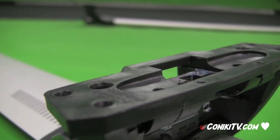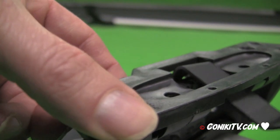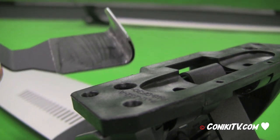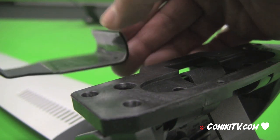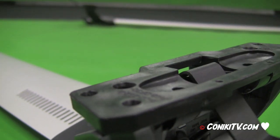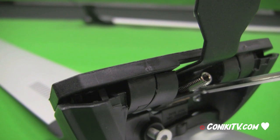Turning the bar upside down to demonstrate: the bracket has to fit in from below, so lift the bar up slightly, push it in, and it hooks in underneath. On the fitted bracket there is a little plastic coating — peel the adhesive tabs and place them on the bracket surface. This stops friction between the metallic surface and the paint of your car, minimizing any scratching. Once the bracket is in position, insert the screw from underneath and that holds it in place.